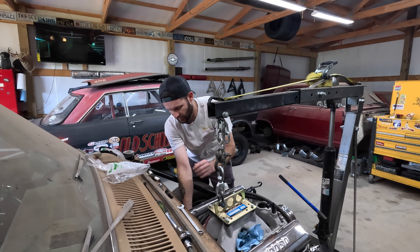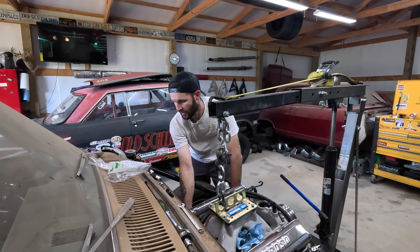Today we're going to start the process of actually putting this car together with stuff that's going to be staying in place. The first thing to do is pull the drivetrain back out — this motor needs a new rear main, and with the Mustang 2 front end you can't get the oil pan off with the motor in the car. We'll also get the floor shifter removed now that we've got a functional column shift. The headers need to come out first before the motor can be removed.